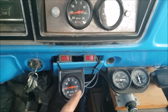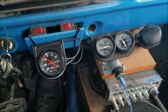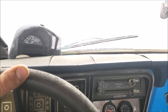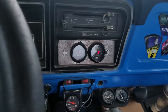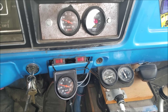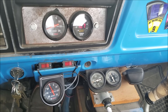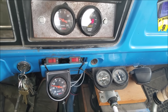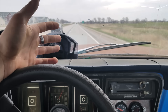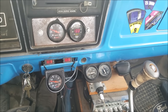If we open the throttle a little bit more, you'll see that ported vacuum and manifold vacuum are exactly the same. When I shut this off you can watch the vacuum drop to zero — and again, this is teed into our ported port. Out on the interstate, as I work the throttle back and forth, our vacuum signal changes. If I completely let off, manifold goes high and ported goes to zero. When you're into the throttle, they're exactly the same. The only difference between ported and manifold vacuum is that one does not add ignition timing at idle.